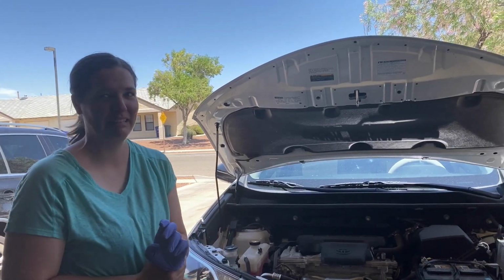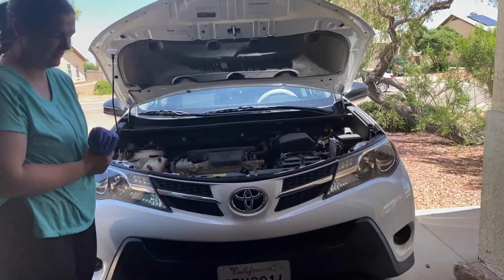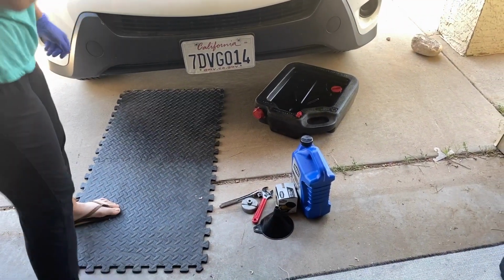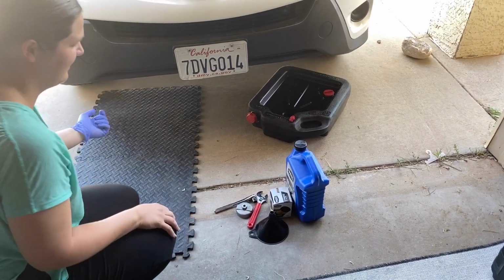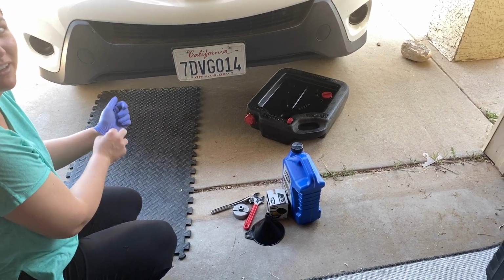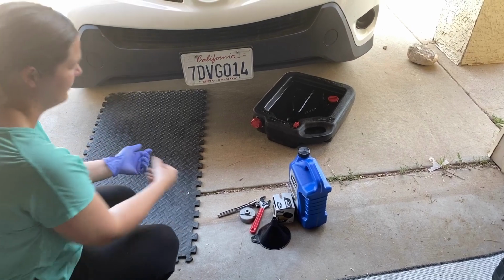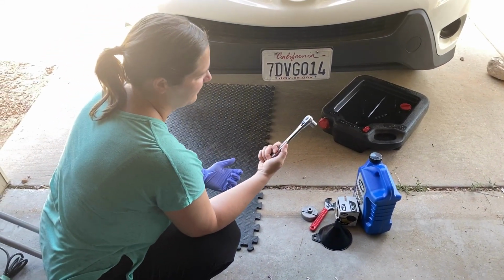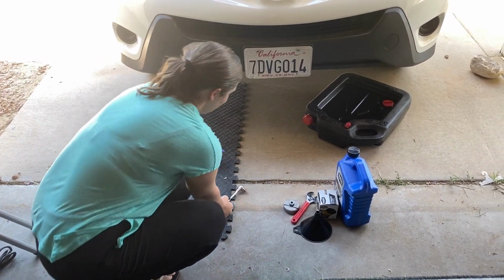Next step. Get the tool, the ratchet with the 14mm socket. Okay. And then get your oil pan. And then go under the engine. Now, do I just move that where it needs to be right now? Just slide it off to the side now, because I'm going to use this to break the torque first on that oil pan bolt. Once you start loosening it with your hand, then that's when you get the drain pan under there.